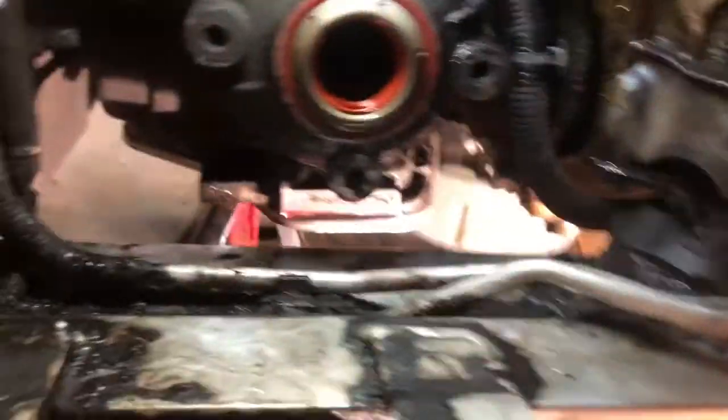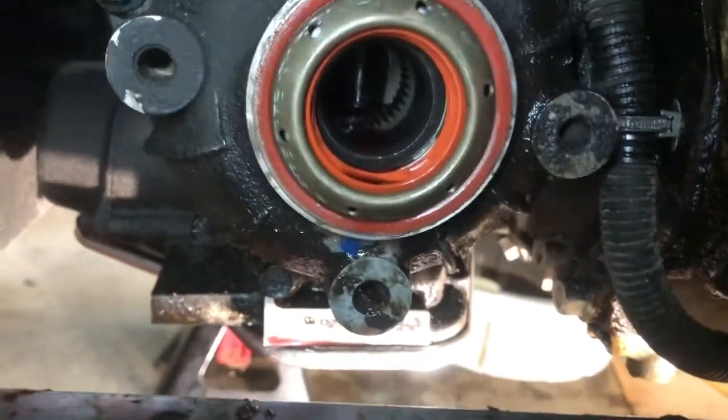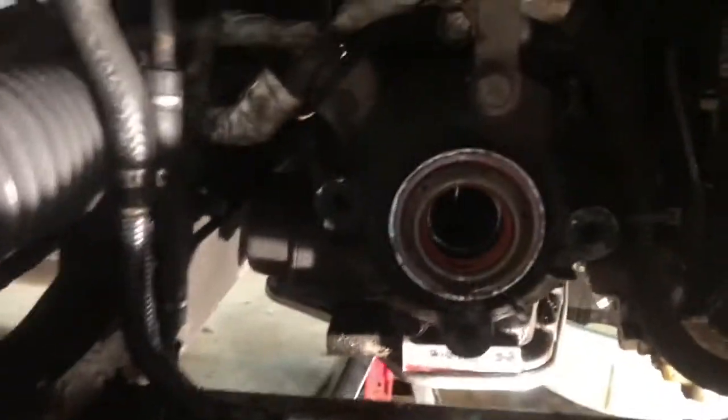There's the new seal installed, and you can see inside there's really nothing blocking — no damaged gear teeth or anything like that. The seal's in there straight; there should be no reason this shouldn't go in. What we're going to do is put the new lower control arm in — it's right over here — get that installed, get everything else put back together, slide the new axle in, add some transmission fluid, and make sure it works. I'll update you in just a little bit — it's 7:35 and I don't want to be out here all night.